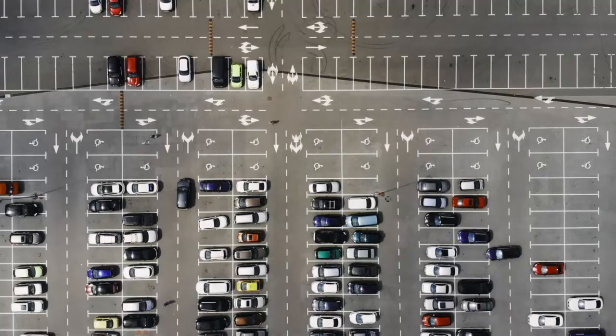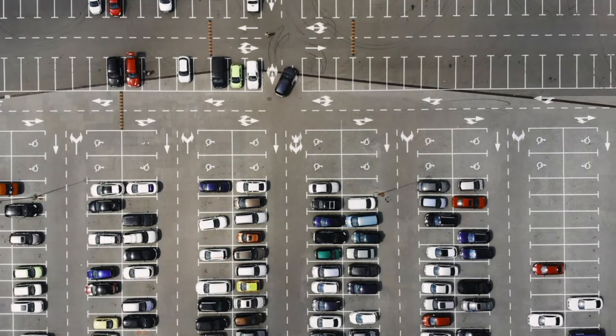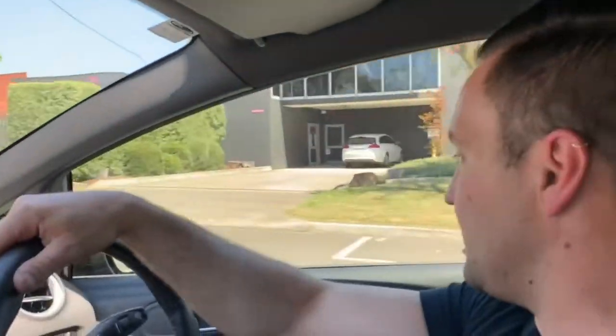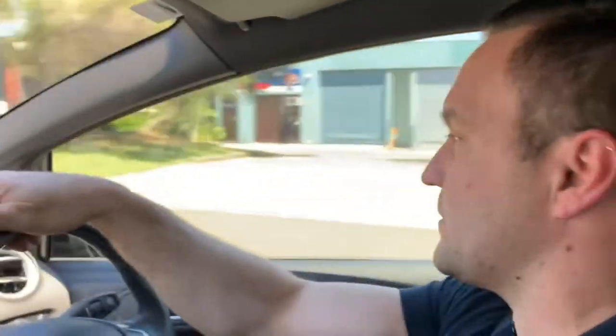It's one of the big problems that we see a lot with the European reflashes, or the reflashes that are done basically in a car park without really any checks and balances into the tune, is that you get a lot of unsatisfied customers. And not only that, it's actually pretty bad for the engine as well. We've seen a few failures as a result of a bad flash tune.